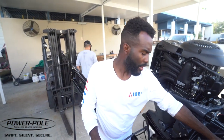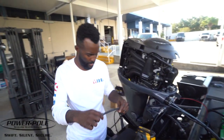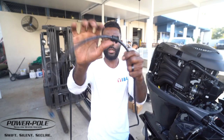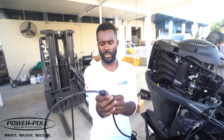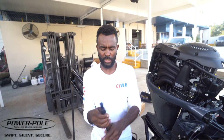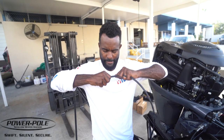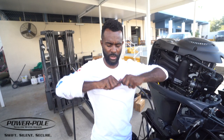I've already got a rigging hole right here on the transom of the boat that I can run my hydraulic lines through. All the Power Pole hosing comes with a grommet you can use — if you've got fiberglass and have to drill a new hole, the grommet keeps water from continuously going inside the transom. Since I already have the hole I don't need the grommets, so I'll just take both of them off the up and down hose.